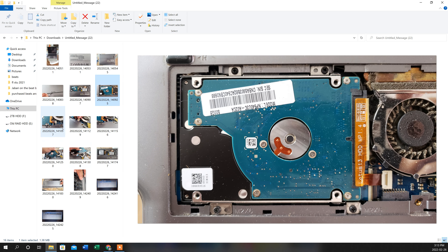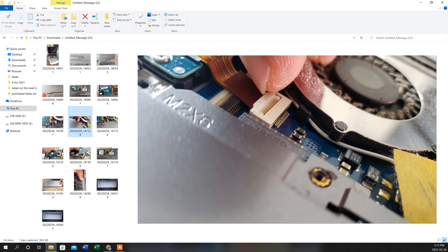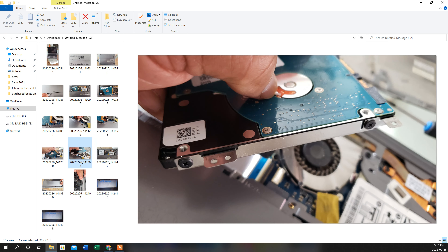This is the lock position on the SATA cable. All you have to do is put your fingernail underneath this latch and lift it upward — click it upwards. This is what it looks like once unlocked. Then carefully, as you can see zoomed in, pull on the tab to the left side and it will just slide outwards. That is the best way to do it.